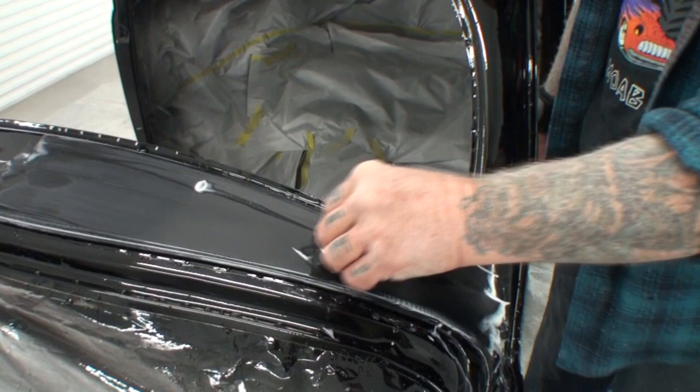Well, we got to get it down to 3,000. What the 3,000 on the DA does, it kind of gives it a semi-gloss buff. So what that does, that saves on material and time when you're using your buffer. But yes, Minnie is right, you can actually buff that out just like that. That is some awesome sanding right there. Look at that.